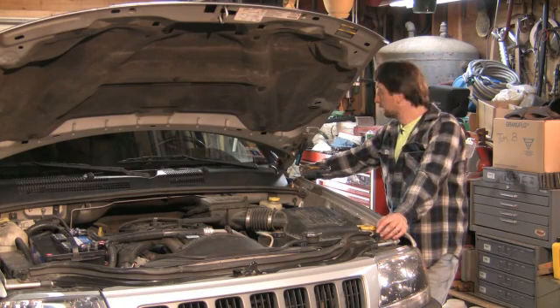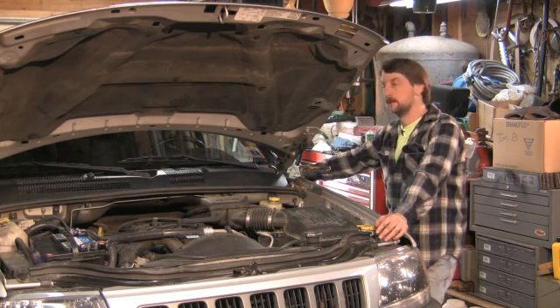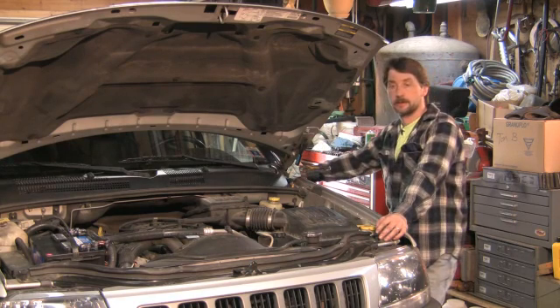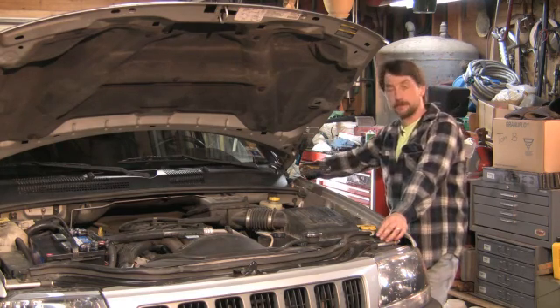Outside of that, there's really not much to an alarm. Like I said, they've got a few sensors: one on the hood, one on the interior for the door light switch, and a motion sensor if somebody tries to move your vehicle. Most of the time they'll also have what they call a starter interrupt — if somebody does break into the vehicle and it's not key coded or they don't have the password or the remote, it disables the whole ignition system so the vehicle cannot start. That's basically what it comes down to with the vehicle alarm and how they work.